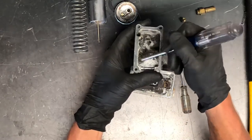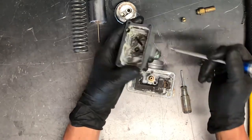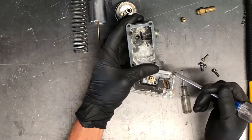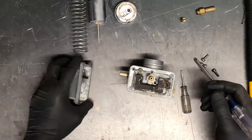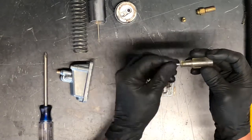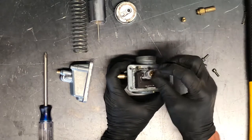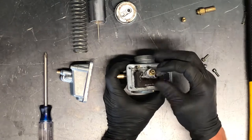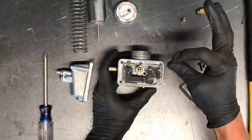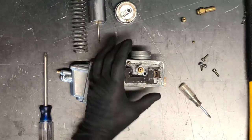As you can see it's corroded, but not a lot of buildup — not a lot is going to come off here. This carburetor will work. If you've got some kind of a bead blaster you can spray that and clean it up even better. We've got your pilot jet, and this is going to be a challenging thing for these older bikes — it takes a really small flat screwdriver. Clear down in that hole there is a pilot jet, just a small little jet. You want to make sure you pull that, make sure you blow through it, and make sure you're getting fuel flowing through it. Hold it up to light and you'll be able to see through that small port. If you can't see through it, then you've got problems.